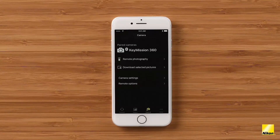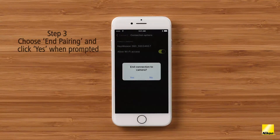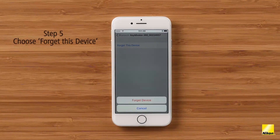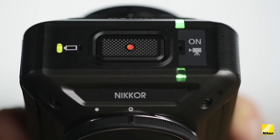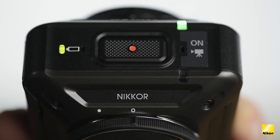It's useful to know how to stop pairing your device and your Key Mission camera, as well as how to re-pair — in other words, how to reconnect the two. To end pairing, navigate to the connect screen and click on the center Bluetooth icon. Choose End Pairing and click Yes. Now go to your device's main settings, choose the Bluetooth menu, scroll down to Key Mission Device, and tap the blue information icon on the right. Now choose Forget Device. To pair your device to the camera again, you need to set the camera back into pairing standby mode. Press and hold the video record button for roughly seven seconds until you see the two blinking green lights. Soon the lights will begin alternating — the camera is now ready to be paired with the device.